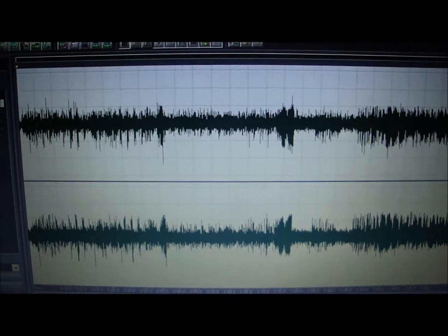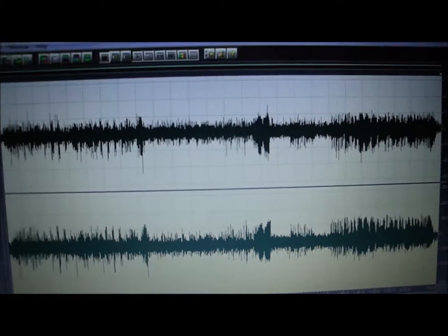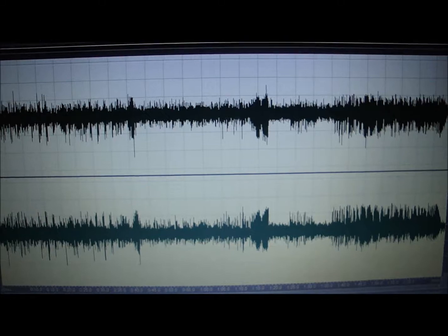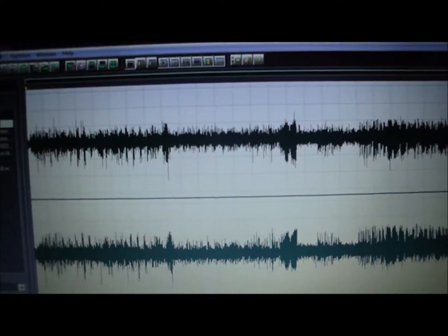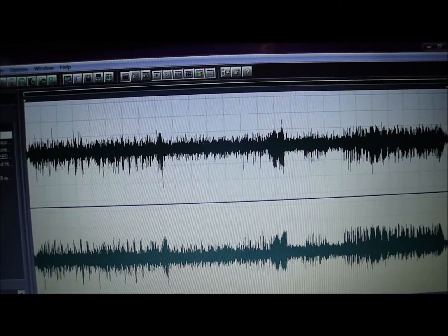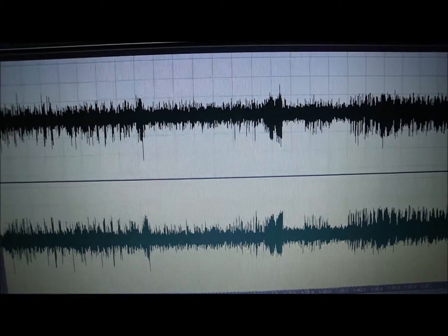This is probably the one step that most people don't realise. All these decks have this curve programmed into it because they're all designed to play modern vinyl. They're not designed to play 78. So since a lot of people don't have their own amplifiers, and I don't, you have to apply this reverse curve, because otherwise everything will sound completely muffled in the higher frequencies, and you don't want that because it will kill the record.